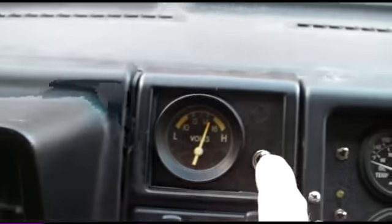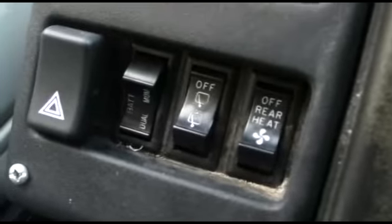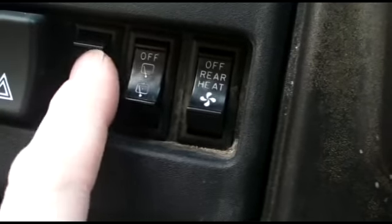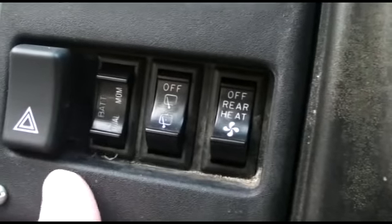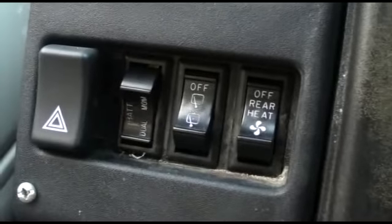The van battery. That's the coach battery. There's a little switch over here. Right now it's on dual. That's the alternator basically, charging normal, and then you parallel the coach battery to charge that.